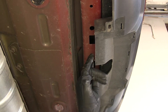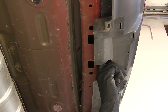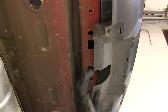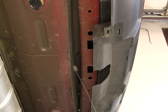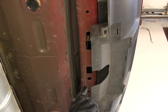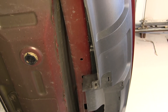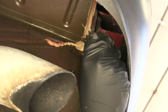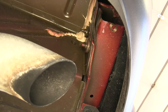At the center at the very back of our bumper, if we look up we're going to have two rectangular holes as well as two circular holes on the outside of those. The round ones are going to be a mounting location for our hitch, but we're going to have to get our hardware in place first. We'll take our pull wire, feed the coiled end in, and go to the outside of the frame — feeding it all the way in until that coiled end comes out the outside edge of the frame. Put a little bit of a bend in there so that neither side falls back in.